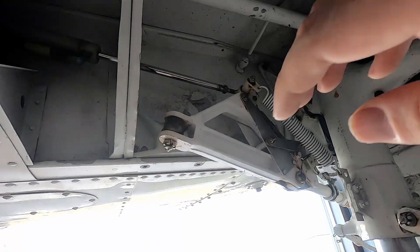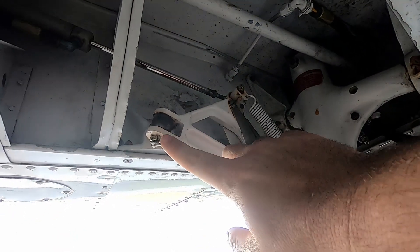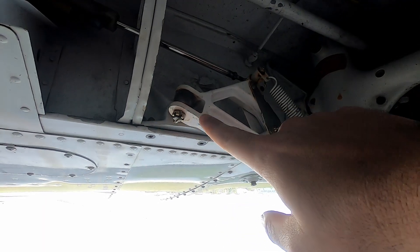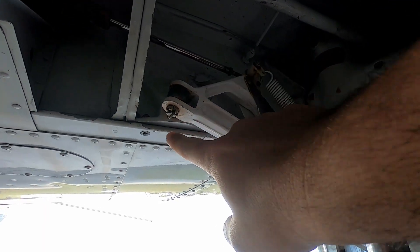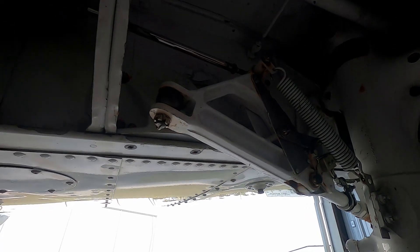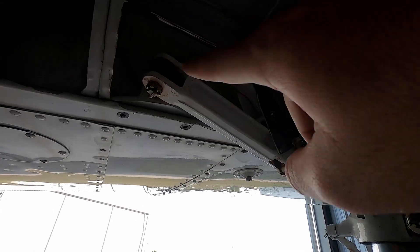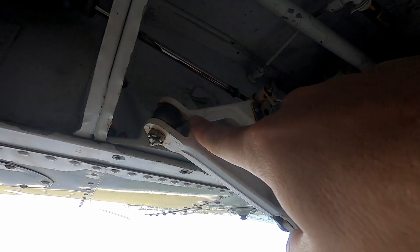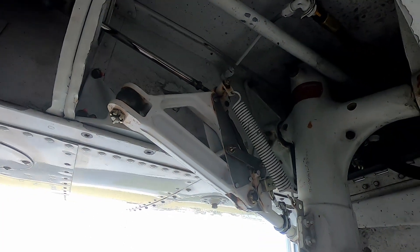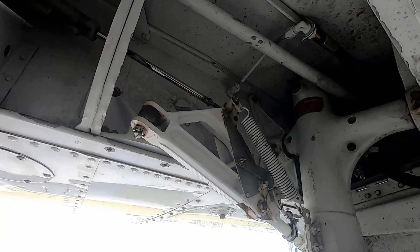During the annual, on the main landing gear — here's the right main gear up in the gear well — there's a knuckle with a 500-hour requirement to pull it out and NDT the pin inside. A non-destructive test, essentially a magnaflux. It's a 500-hour requirement, or you can replace the pin. We did the 500-hour inspection. We probably should have replaced the pin, but we'll get to do it again in 500 hours.